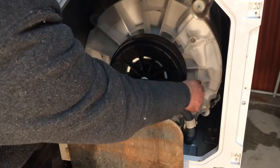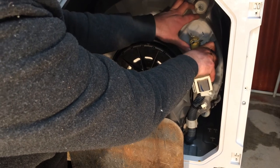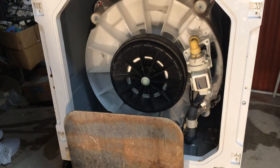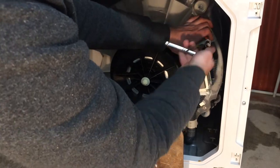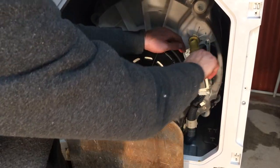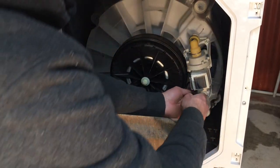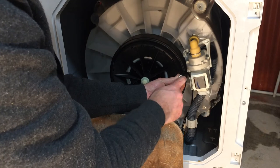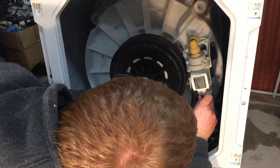We've got one screw here which we only partially undid because this here is just a clip rather than a full circle, so we're just going to pop that onto there. Then we push this hose on — which should hold it in place. Don't put the clamp on until it's on all the way. We have the two screws at the top and we still have that bottom one we need to tighten up. That clamp we can move out of the way so it looks a bit tidier. Then there's this one more screw down here, and finally we have this plug — it's got three little legs on it so it can only go in one way around. It's 240V AC.